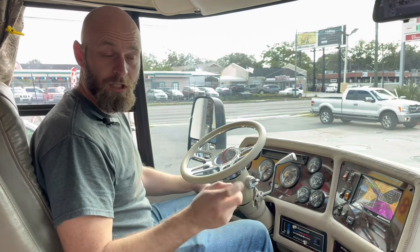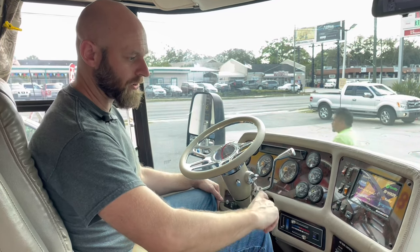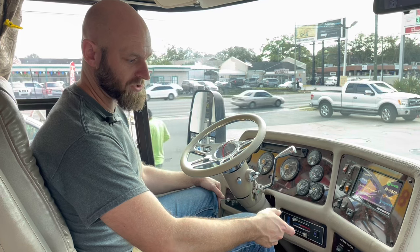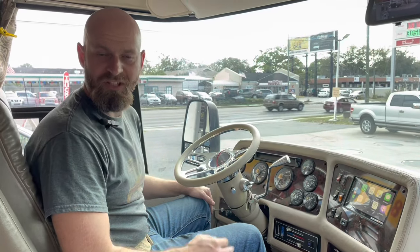And if it ever has trouble and doesn't start in that first couple seconds, a trick that you can do is turn the key on, let it cycle through that, turn it off, turn it back on, let it cycle through that, and then crank it up. That gives it that little extra burst of fuel, so it's almost like a choke or something. Like the extra pump.